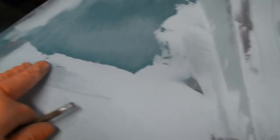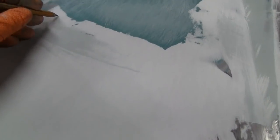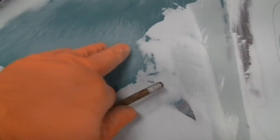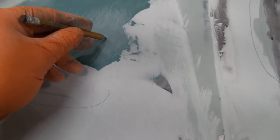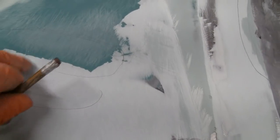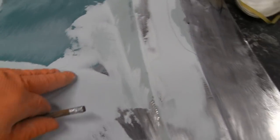But I have a low spot here, and I didn't realize it, but you can see over here where the sandpaper was hitting. So this means this is where I'm running out of lead here. This is where it levels out. So I'm gonna grind this out here down to the metal, and then we can fill that in.